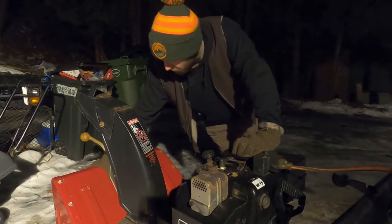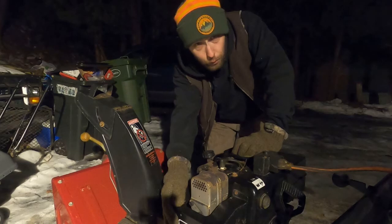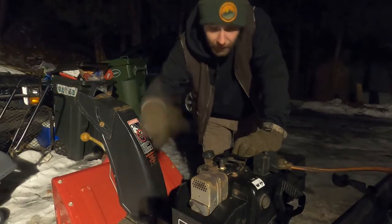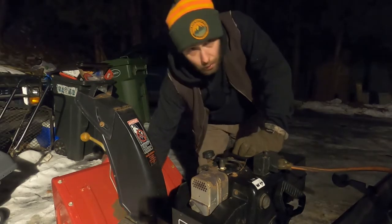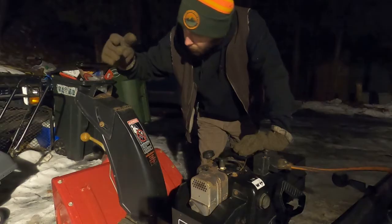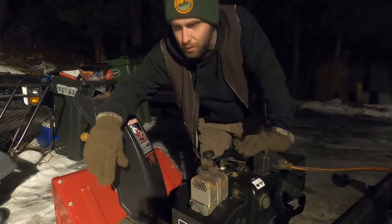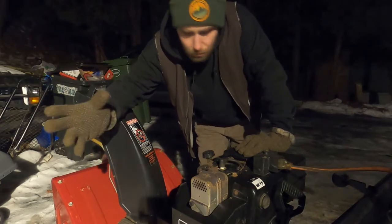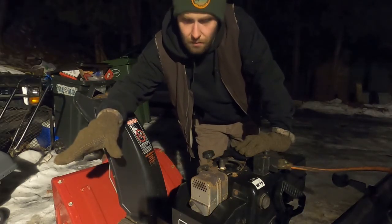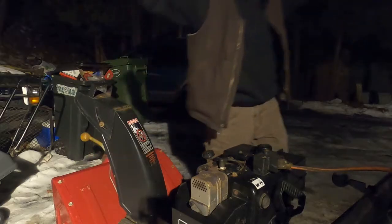Now I have to actually fix this Toro, so there will absolutely be a part two — I want to see what's in that carburetor now. I suspect it's got some old gunk in there just like all the rest of them, and nothing that little bottle can do will change it. Leave me a comment down in the squawk box if you think I was unfair on this product — let's hash it out. If you've used similar products — from Gumout to Seafoam to Rislone to Marvel Mystery Oil — they all try to do the same thing, but no shortcut is ever going to be as good as doing it the right way: pull the carburetor, clean it, put it back, go to town, you're done. Video over, I'm out.